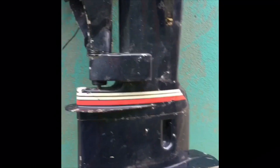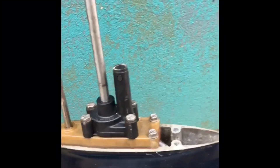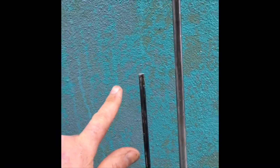First thing I'm going to do is take off this spacer section and show you what that looks like. So this is the spacer section duly removed and put to one side. This unit then fits back on top without the spacer section, so it's consequently shorter. Now, this is the gear lever here — I've already cut a section out of it that is exactly the height of the spacer. This will be welded back into place and it's been marked so that the gear change will operate as it was.